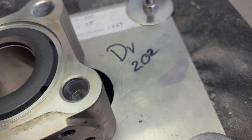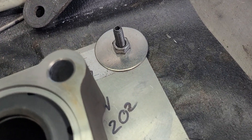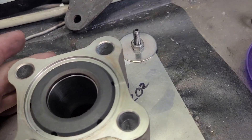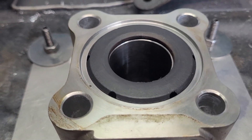Full disclosure — we have this on top of a 200 CFM plate. It's a solid chunk of stainless, so it's quite heavy and it has a really nice machined surface, so it seals quite well. I had a feeling it was going to be a little bit less flow, so let me throw a quick radius on that with a little clay and see what we get.